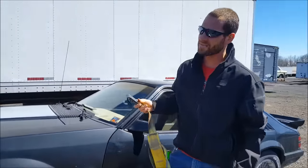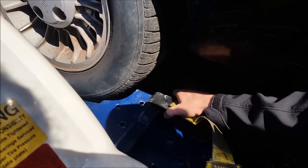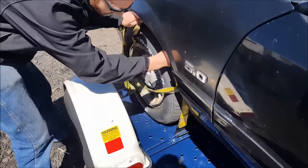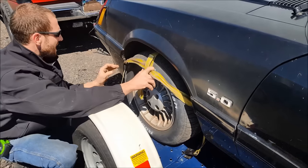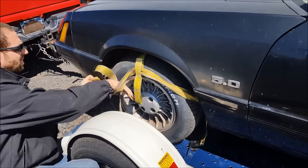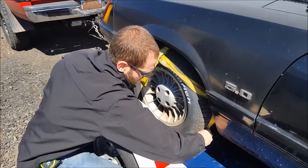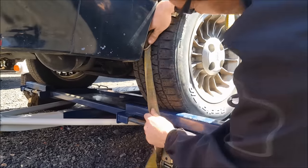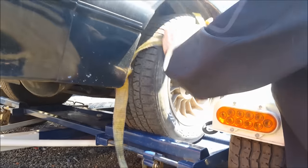Kind of important here: if you're putting a vehicle that has very large tires on it, you might want to hook these on here first because sometimes it can be pretty tight to hook that up. You have different loops here for different positions depending on where your tire is actually sitting. Put it on the one that matches up best and start rigging this thing up. Make sure you don't have this all twisted up. On the inside, make sure you're not around any brake cables or brake hoses where you're going to damage things. Make sure this side's taut, then come over and set it so your ring is in the center of the tire — about midway. Then go ahead and loop this back through once.